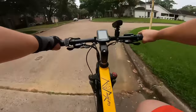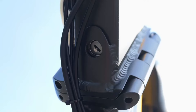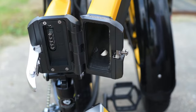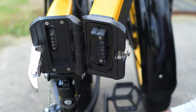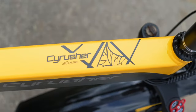That's something to take into consideration depending on how you'll use this. If you have about a 30-mile commute — 15 miles one way, 15 back — you should be safe with the 690. One of my favorite design features is the charging port location on the lower half of the folding down tube. With most batteries you just plug straight into the battery through a small hole, but this design lets you plug in here at the back. It prevents damage if you pull the battery out while the charger is still connected, and avoids the plastic cap grommet issue — a small attention-to-detail I really like.